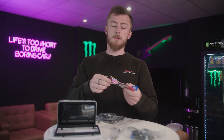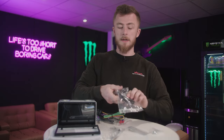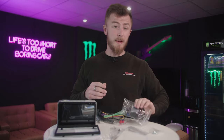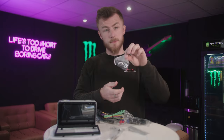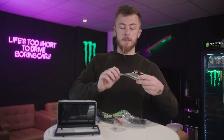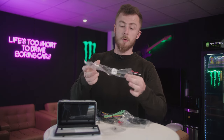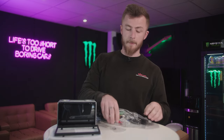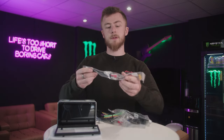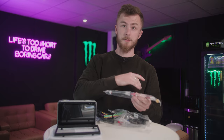This is your main harness — a direct connection from the back of the stereo to ISO. This here is your GPS antenna; this one comes with a separate GPS antenna so it's more accurate for your maps on CarPlay and Android Auto. You have a little bag of screws and the removal keys for the cage. This connection here is your rear view camera input, a mute wire, and steering wheel control input — again on a little white plug for the back of the unit. You've also got some sticky pads to hold the wires, and then you have your RCA outputs — pre-outs for front, rear, and sub — as well as a rear monitor output so you can add a second screen to the vehicle.